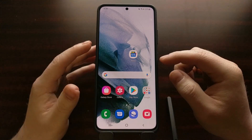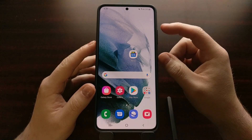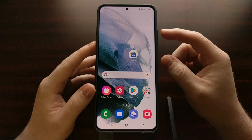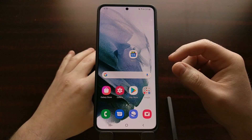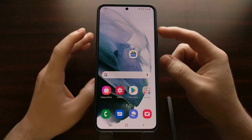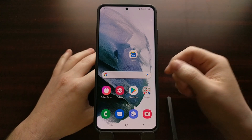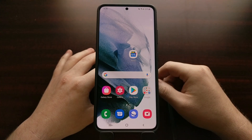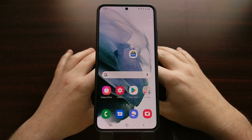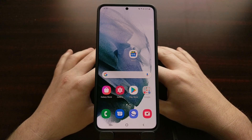When I first got the device, I tried to power it off and boot into recovery mode by holding the power and the volume up buttons. When I did this, it went to a long vibrate as I continued holding these two buttons after the initial splash screen, but then it just booted into the Android operating system.